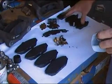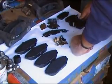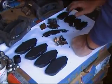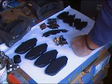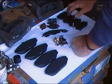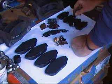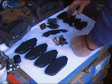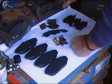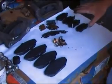Now we still have the same thing to do with all these rear pads here. I'm not going to put this on the video, but I do want you to see one difference on these rear brake pads. You see how they have a squealer attached right here? When I pull these pads off of the back caliper bracket, the pad with the squealer is the inner pad. Make sure one of them is on one side and one on the other side. You check your old pads that come off, so you put the right pad on the right side. The outer pads are the same, so you can put them on either side.